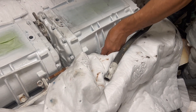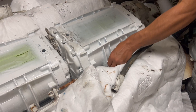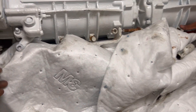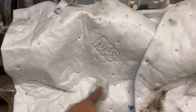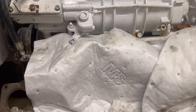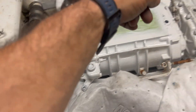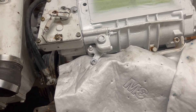We're going to screw everything down and we've got to get the rack rods back in here, which go to the rack assembly arm - that's what moves all the injectors. I've got new gaskets coming so we can put the shutdown back on and start putting this thing back together again.